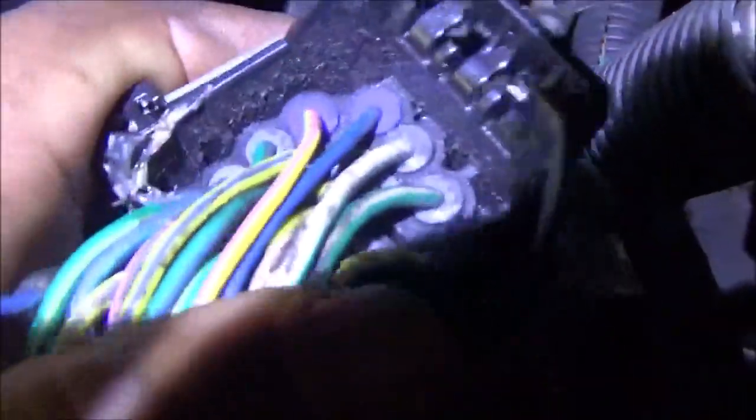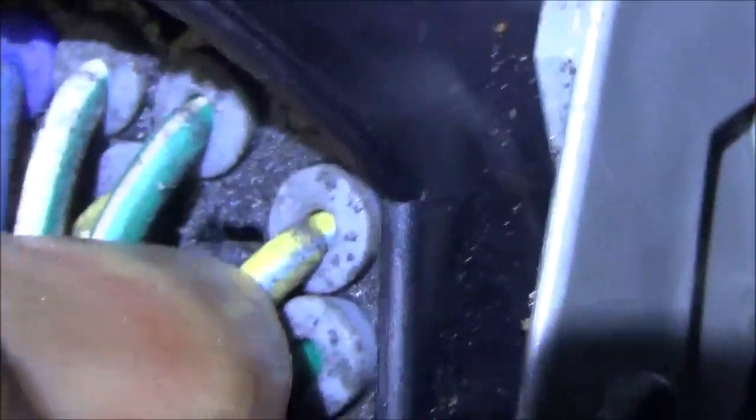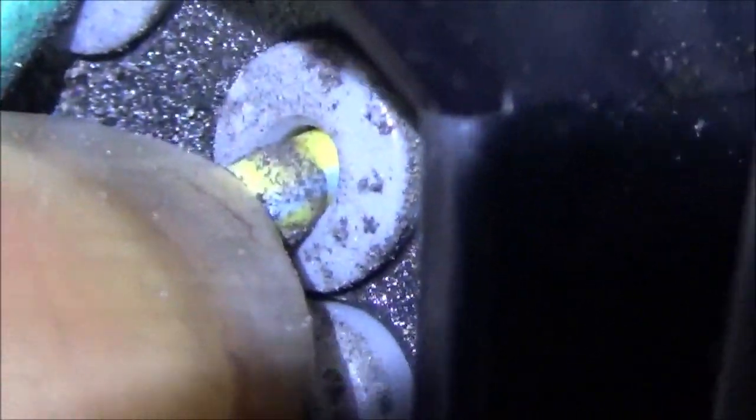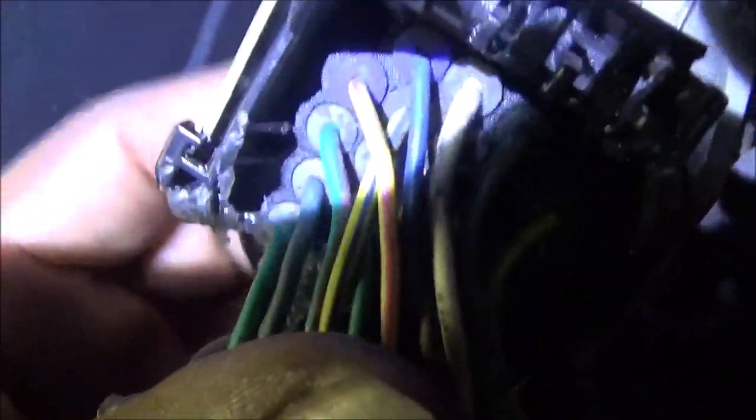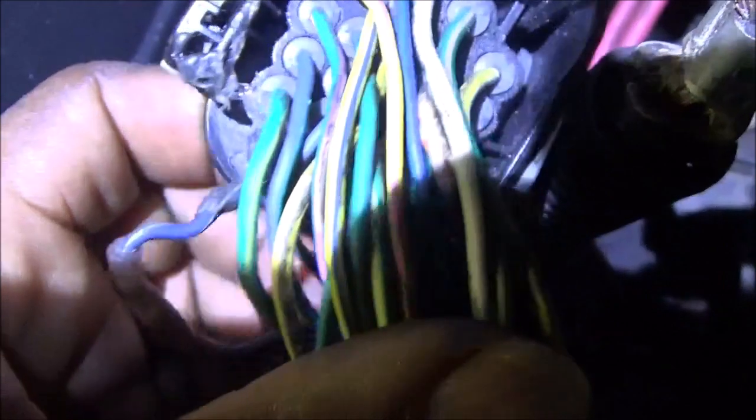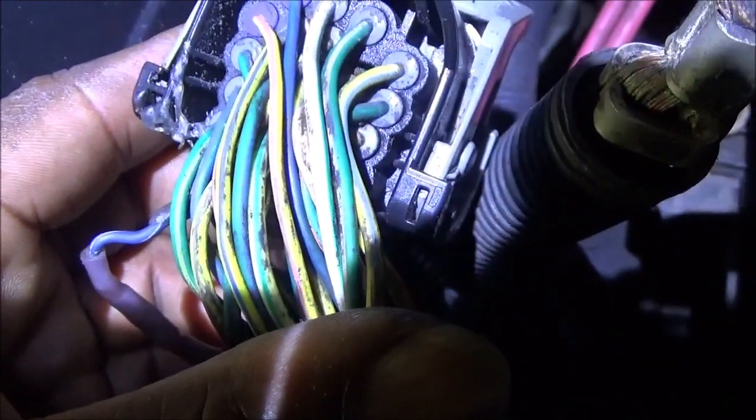I'm up at the top of the vehicle. I'm going to either change this or fix these — and I'm going to fix every single one of them, or change the harness, because I can see little areas where it looks like it's about to break. These wires have been stressed out. If you get a harness, make sure you get one from a later year. I'm going to take each individual one of these wires apart and solder them in, because I don't trust them.